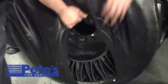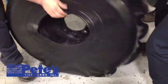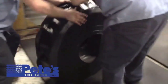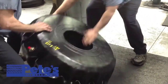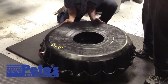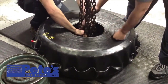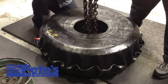The second critical element of the heat and pressure treatment is the application of controlled pressure to the retreaded Michelin Tweel. Pressure is an equally vital factor in the curing process, working in tandem with heat to ensure uniformity in the distribution of materials, and to eliminate any potential air pockets or voids within the tire's structure. The applied pressure facilitates the proper consolidation of the rubber, treatment compounds, and the existing tire components, resulting in a homogeneous and well-integrated structure.